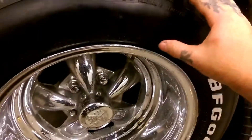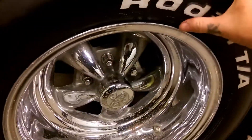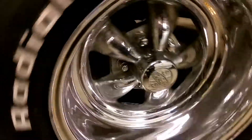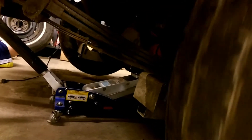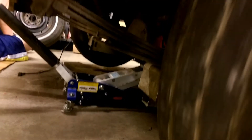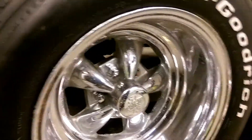The first thing you want to do is find out if you have a posi or an open differential. Right here is a posi — you can see both wheels spinning in the same direction. If they were going opposite to one another, it would be an open differential or a G80 locker. You can check a locker by spinning the wheel fast and hitting it, but if it's still open diff it looks the same way.